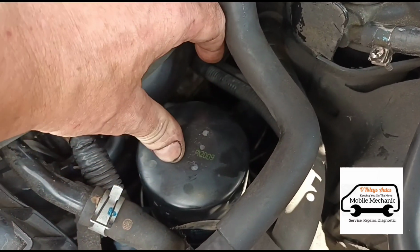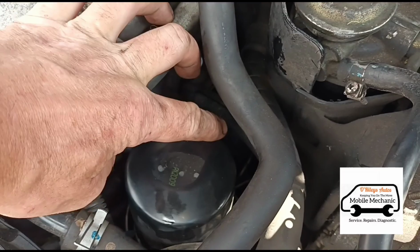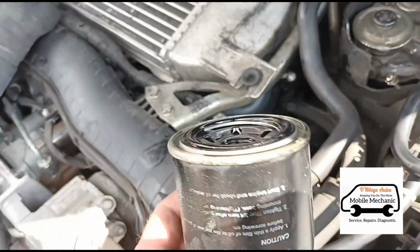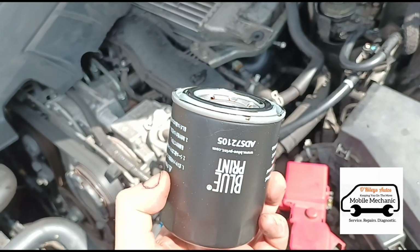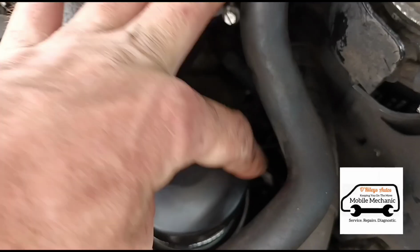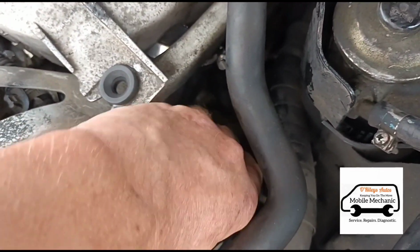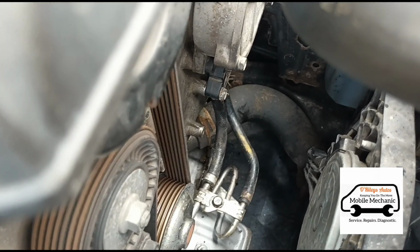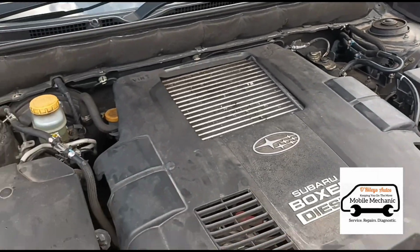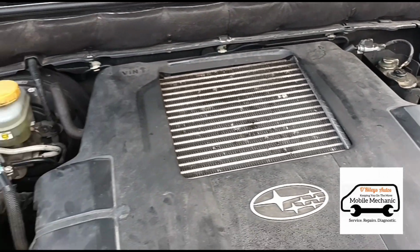And we've got the oil filter just over here. Going to open that up. New oil filter to go back in. It's been lubed up there with some oil and cleaned in the housing. So that's it, we have everything back together there. The DPF pressure sensor is back in, new oil is done, oil filter done. Oil pipe, intercooler pipe, sorry, and the intercooler is back on.